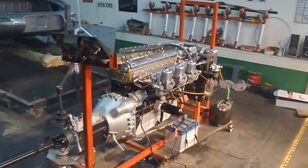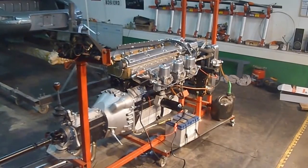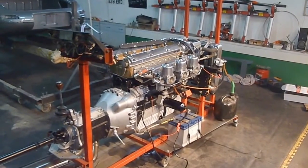The only things that are original are the block and the head, but everything else has been changed. The con rods are the same as the crank, but it's all been re-ground with different sized shells. The only difference, as I say, is the pistons, and you wouldn't be changing them anyway because they do get scored on the skirts. You can see that original one there has got quite a scoring on it. Not a cheap item, though.